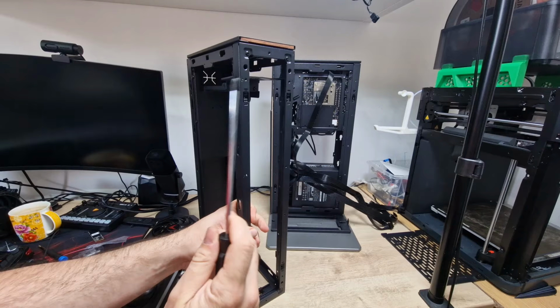But this is the X53, so with a 25mm fan on that, obviously normally the X53 includes the fan, which is 15mm, so an extra 10mm takes us to 63mm, which should be fine for this case, as this can do up to 65mm. So I'm hoping this cooler is going to perform well enough to get us through, but we'll find out soon. So now it's time to get the motherboard and everything installed into the actual case, and then once we've done that, we'll get the power supply in and the graphics card, and we should be good to go.